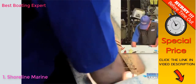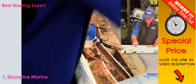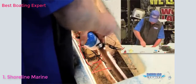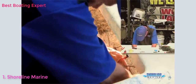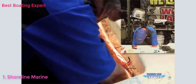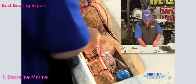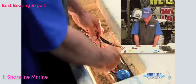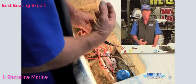Now we make sure that we have our clamp on our hose. Put it together, tighten the clamp up. Snap our pump in. Pump snapped in, and now we just got to clean our wiring up. You want to make sure that your wires come up from your pump and go up above the water level in the bilge that you might have at some time with all your connections, just for added protection for corrosion.